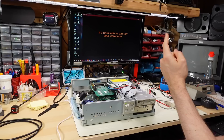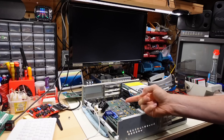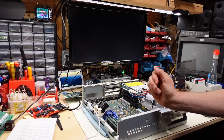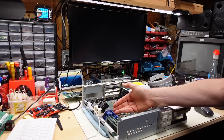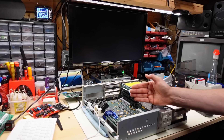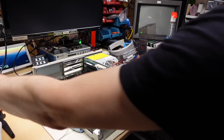After rebooting — and noticing that classic Windows 95 'It is now safe to turn off your computer' screen for AT systems — MemTest86 runs on the 486 with absolutely no problems. It seems to be operating flawlessly. Next I want to run benchmarks on both machines. I'm particularly interested in whether there's any external cache memory on this 486 board, because even though it has a DX2/66 installed, a 486SX-based board typically has no external static RAM cache, which would limit performance compared to boards that do.